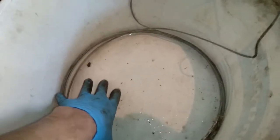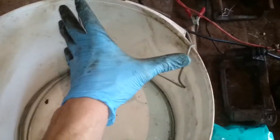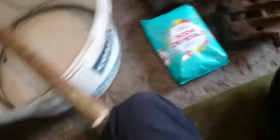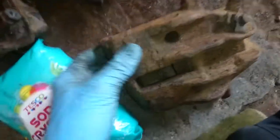So we'll just set it up and show you how it works. We've got a coil of steel wire hooked over the edge - this is going to be our positive terminal, so our positive from the battery charger will attach to that. We've got our broom pole with a couple of notches in it so it sits nice and tidy. I've spent about two or three minutes just knocking off loose rust bits and giving it a quick rub down with a wire brush, just to get the loose bits off and help the process along.